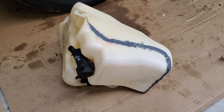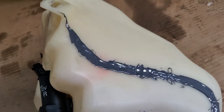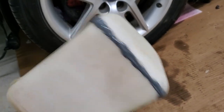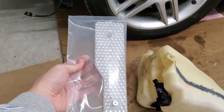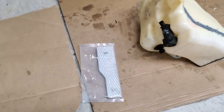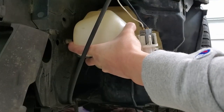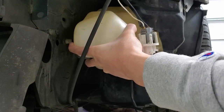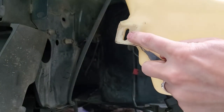The two things I'm knocking out today: the slow washer fluid reservoir leak I've been having — I've already touched it up with some JB Weld but I'm gonna hit it again with another coat — and the second is a dead pedal from Genuine Saab. In order to remove the housing, first you have to undo that handle part right there. You twist it counterclockwise and that will release the neck from the actual housing. There are going to be two T25 screws — one here and the other right there.